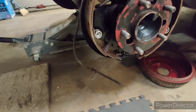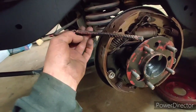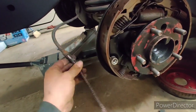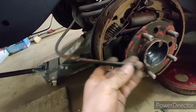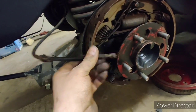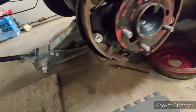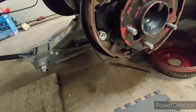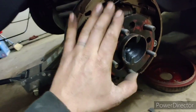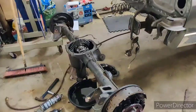Check in on. Man, you want to know what sucks? Disconnecting parking brake lines. I mean, they don't suck. They're just a pain in the ass. You usually got your 4 tabs. Once you release that, you got to bring back the pawl, and then you got to pull this forward and loop it out. And yeah, it's always fun. It's gotten easier over the years. People complain about doing them on old cars. Try doing them on modern cars. They suck. Rant of the current moment.